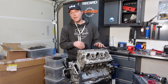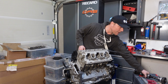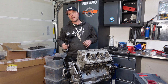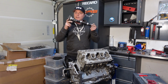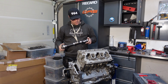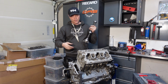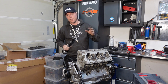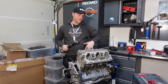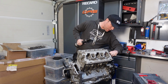There's a very good test you do once you've gotten this far, and that is to take this guy, namely the camshaft, and you actually assemble it. If this guy now turns freely, that means you have succeeded. If it doesn't turn freely, you are in trouble, and you have to untighten everything and tighten it back in a different order and see if that helps. With this method that I use with seating it and unseating it, it should eliminate any risk of that happening.